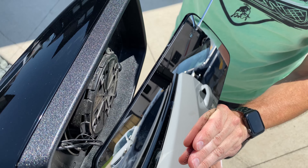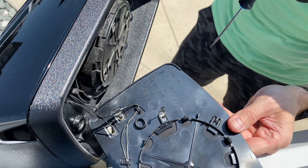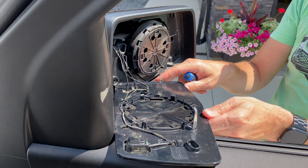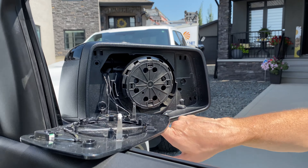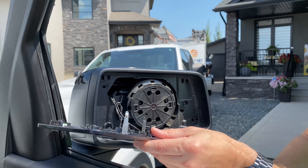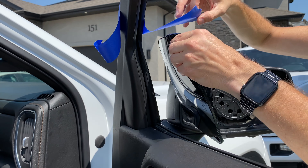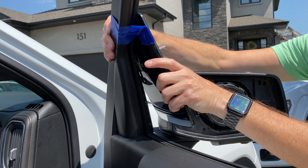There are six clips. Mine has the lane assist warning and also has the heater so they stay defrosted. So I'm not going to unhook any of this wiring — I'm just going to rest it in the mirror cavity and with the windows down on the ledge, so that way it's not going to fall. Now we need to get a Torx screwdriver to undo a couple Torx screws. I'm just going to tape these up so they're out of the way.